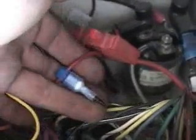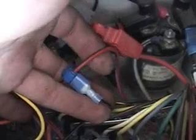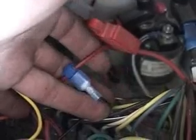The red and black wire coming off of the buzzer is the negative side. And because Bluebird shares the wire for all their emergency exits, we use the diode sniffer. So the black and gray wire from the child reminder gets installed onto this red and black wire coming from the buzzer, and you need to install the diode sniffer on the back door.